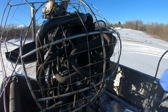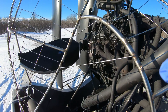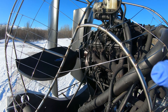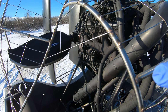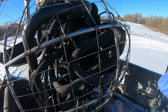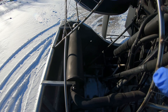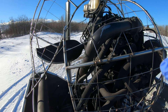There's no question that the airboat is pretty loud, and the main noise really is from the prop. When I built it, I did try to make it as quiet as possible, and with that I went with a super wide prop. The purpose of that is to have a big prop spinning as slowly as possible, and that should minimize the noise at least a little bit. It's a 5.3 LS, it's got the turbo — the turbo reduces the noise a little bit probably — and I do have a muffler on it. So the noise is really not so much the engine; there's a little bit of exhaust and engine noise, but by far most of it I think is the prop.